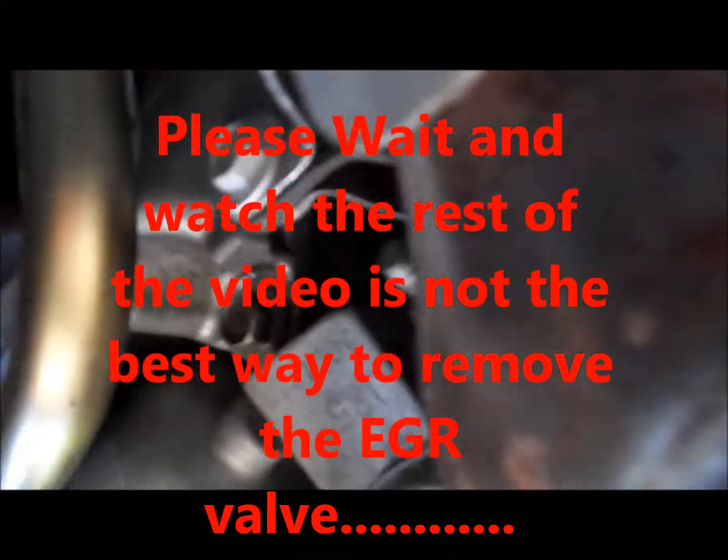Okay, you follow the pipe all the way down, and right there are your two bolts. The easiest way is to do it on top with a small socket. There's one there, and one on the other side. With a small extension, you can do it. Don't do it from the bottom. There's no room, and you're going to end up stripping it because you're not going to get the proper angle. So go ahead, and I'm going to remove those two bolts and go from there.